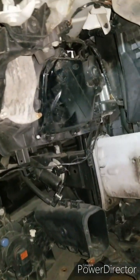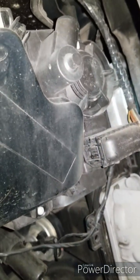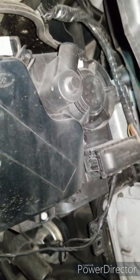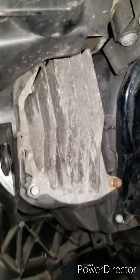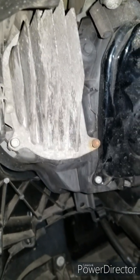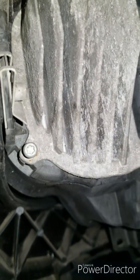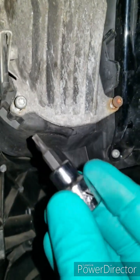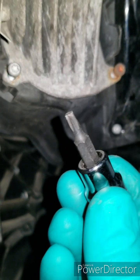The plastic wheel well is out in the front. This is the headlight unit — you also have easy access to the Angel Eyes light bulb if you need to. But this is the unit we're going for. This is the indicator unit that's failing. It has three mounting screws. One is on top but that's the one that's difficult to reach — it's a Torx screw.